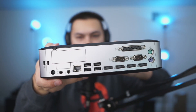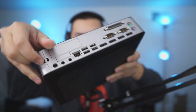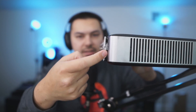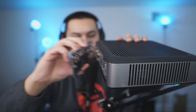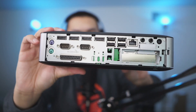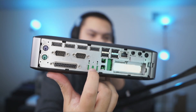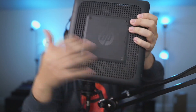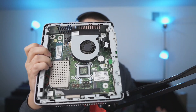To open up this HP T730, we have to take off the back panel. There's a little tab here — be very careful, this tab can break pretty easily. So just gently pull on this tab, and then you'll see it start to separate and you can just kind of follow it all the way back. Then you want to find this green slider and slide it — this is your side panel release. The side panel with the HP logo can just slide off, revealing the inside.